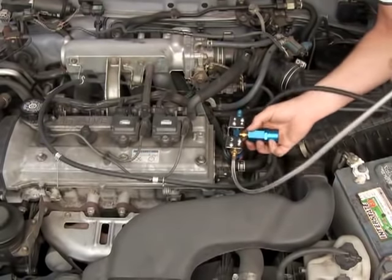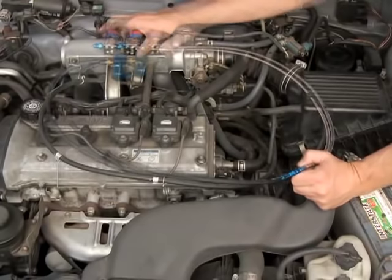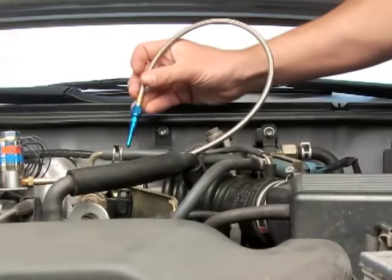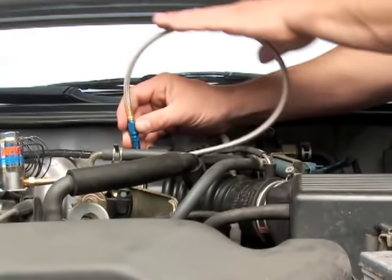Place the temporary plumbing assembly under the hood and look around for the best point to introduce the nitrous into your engine. The nozzle and hose will most likely need to be inserted sideways rather than straight down because of hood clearance issues with the hose protruding from the nozzle.